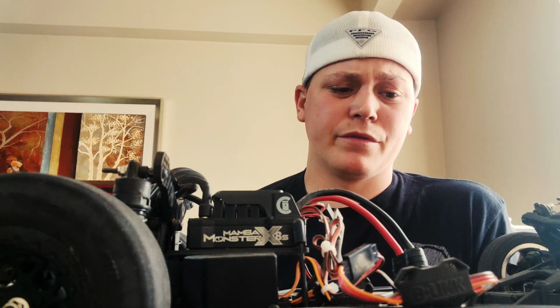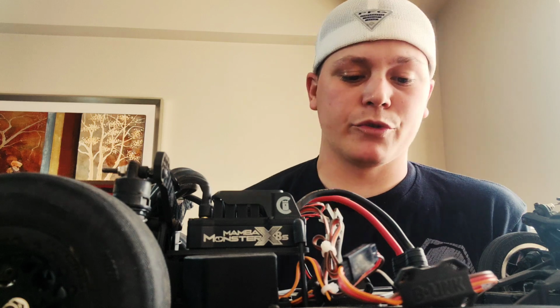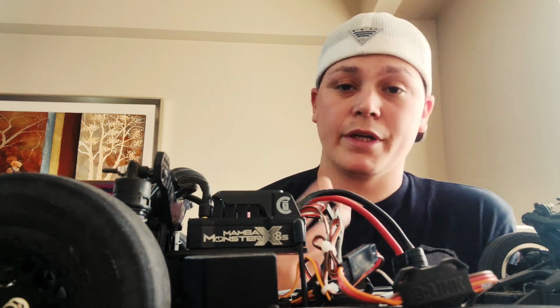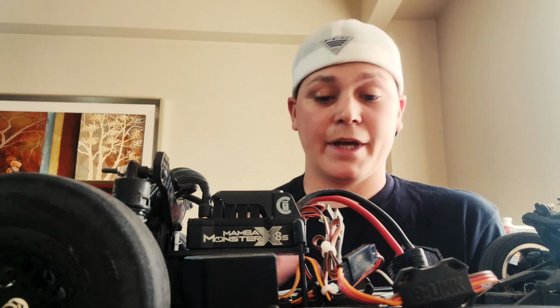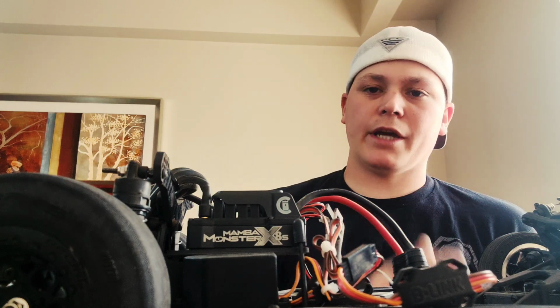But you can do a run at an event, at a competition, and be like, oh well, my punch was too low, I struggled off the line. You can jump on your app, run down to punch control, or go into ESC settings, run down to punch control, turn that up or down, and run it again. You can adjust your throttle curve. You can adjust everything that you can do with the Castle Link, but you can do it with your phone and mobile. You don't have to drag your laptop out and around and deal with that. So personally, that's something I would do right off the bat. I would buy the Castle Link and the Castle B-Link.